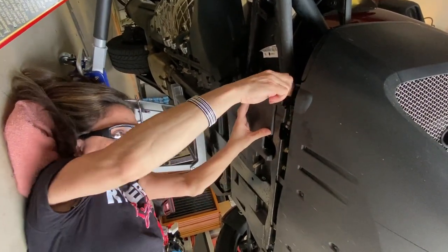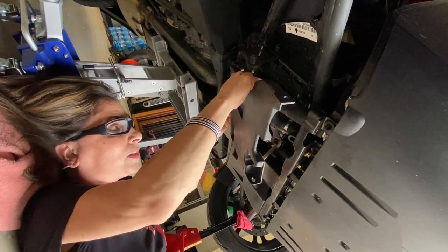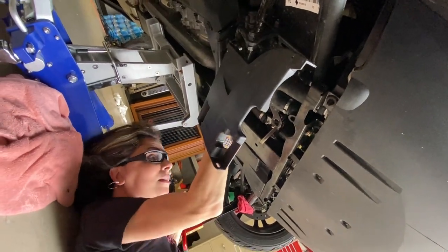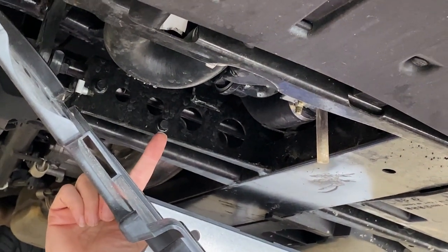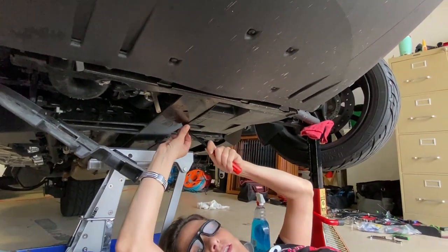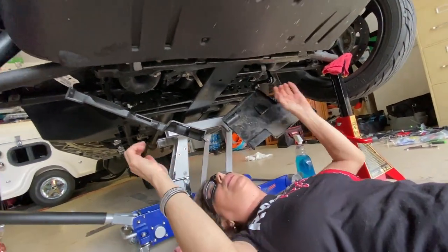This push pin is out, and now there's going to be a hinge right here so it's going to hinge forward. There's so much stuff that falls out — definitely want to wear goggles. You want to be careful; you could unscrew this, it's probably better to do that. All you need is to be able to access the bolt in here. That's why you need to take this off on both sides.